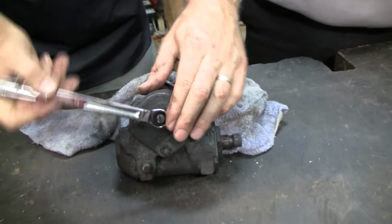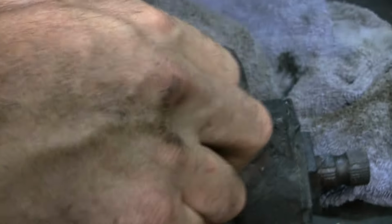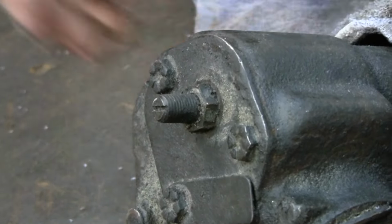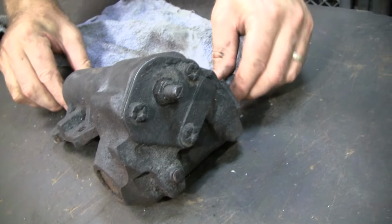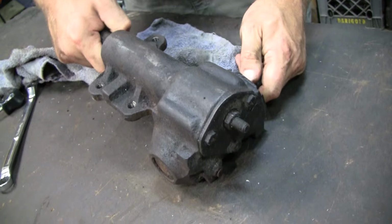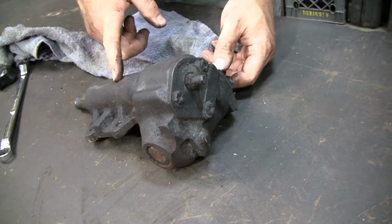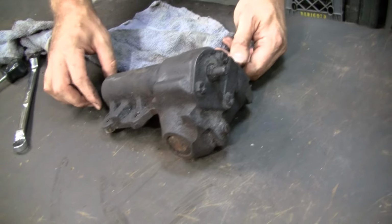Oh, wrong end of the wrench, I think. So he's going to go another quarter turn on the box, and then he can feel it on the rag joint. And by the way, when he's doing this in the driveway, the tires are straight ahead. Now he's going to feel, and this one I knew had slop in it. Maybe he's going to say, that's good enough. And this used box, that actually did it. I don't feel any slop here. I'm moving back and forth, and I got this firmly planted. Look at that. So on this particular old box that somebody turned in for a core on a rebuilt, they actually could have gotten by for a number of years without buying a rebuild from us if they had known that.